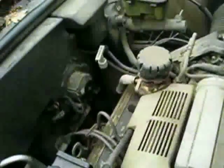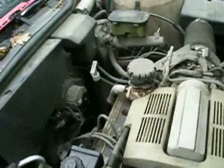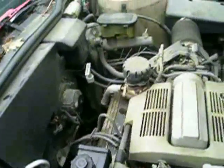Speaking of lines, down there are some transmission cooler lines that are rusty. Now, on your car — at least on the car I was asked about by the YouTube user — you may have a different ignition system, which actually mounts up here and is serviced a little differently. I'm told that on the other type of system, these individual packs actually come off. But if your ignition module is bad and your service engine light is on, you may find that your engine light will not go off until you replace the module. But you can go quite a ways before the module finally gives out for good, although it may leave you stranded somewhere.